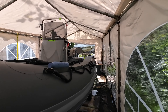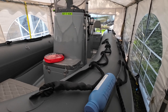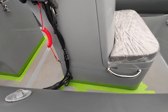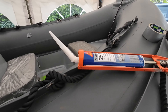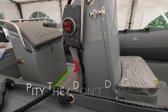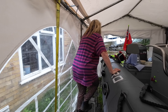Ever closer to the next test. I'm now going to get the Sikaflex to bond the rest - the last bond on the seats and console. We're now doing the Sikaflex final bit around the seat and the console. We've masked up all around and we've got an angled adapter on it. We're using Sikaflex 291i white, because it's the only colour available - white or black. She's going to do the squeezing and the smoothing.